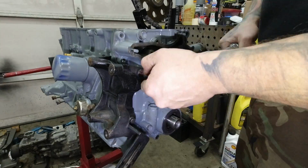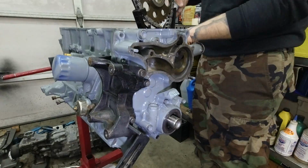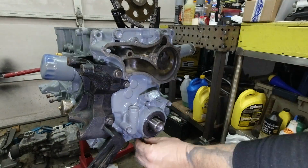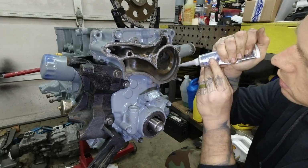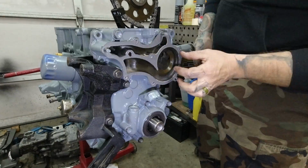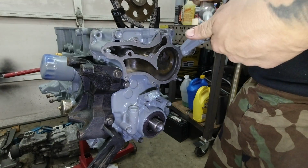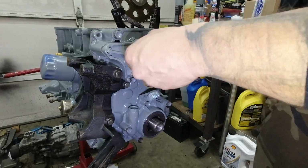The AC bracket also has bolts that run through the timing chain cover, so we get that installed. Don't forget the bolt on the back side near the water pump. Then we can get to the water pump itself. Once again, thin gasket sealant on the block side, thin layer of gasket sealant on the water pump itself, paper gasket in between, correct length fasteners, torque to spec.